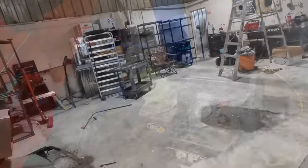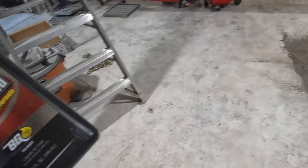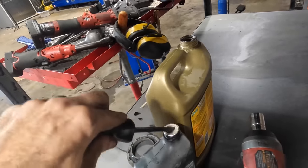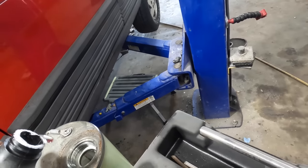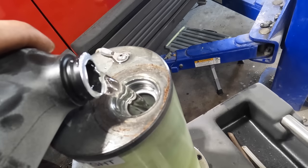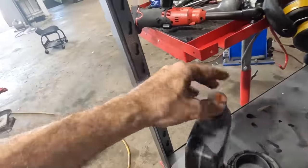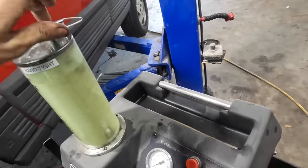We have to dump all the pressure before opening the vessel, otherwise it'll shoot fluid out like a geyser. Back to the cabinet for another brake fluid bottle — BG ultra-dry formula. Pouring it in long range without a funnel, because a funnel could contaminate the fluid even if cleaned with brake cleaner. That's about full with just a half ounce left to save for topping off the master cylinder. Cap back on, air pressure powering back up.